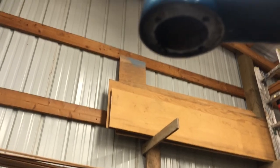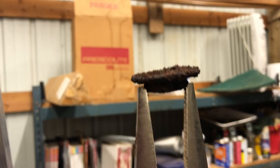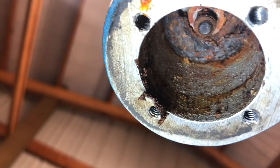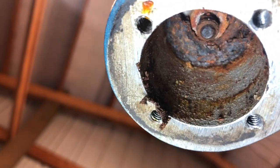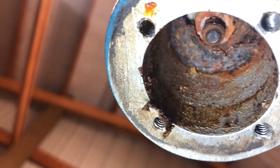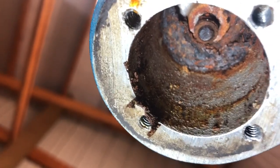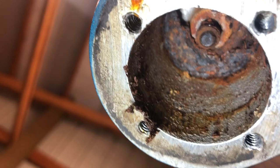I was just able to extract this nasty looking spring seat out of the bottom of this thing. I can get some light up in there — there's that screw I'm trying to get out. The thing is wedged and rusted in there. The housing is aluminum and the screw is steel — dissimilar metal corrosion, rust, everything.